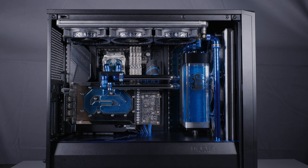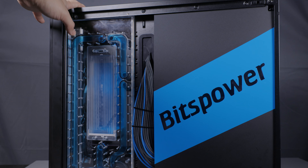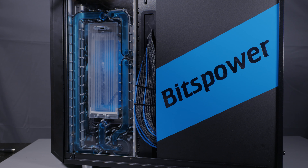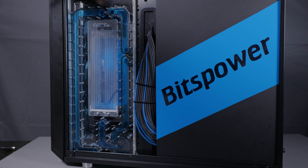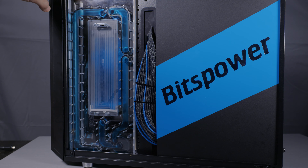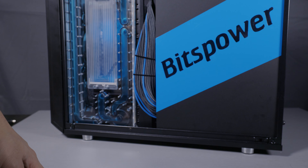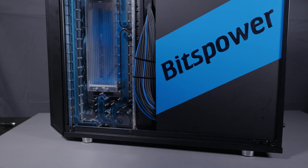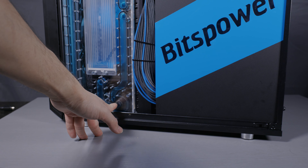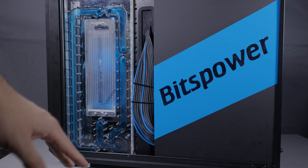Let me turn this around and show you guys the distro. Here's the back of the case. This is the actual distro that was made for this case. This design will fit any R6, R7 possibly as well, and S2 obviously. What I did was remove the original drive bracket and mocked up something that would fit in this space. The distro holds the reservoir in place and has a DDC pump top built in. This way it also cleans up the loop — from the front you just see these two runs and that's it. I also have one at the very front of the radiator.